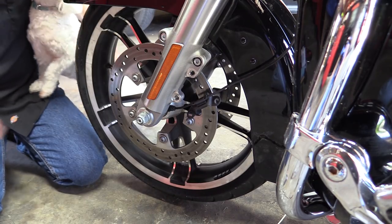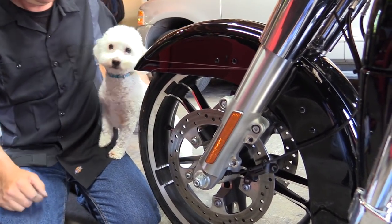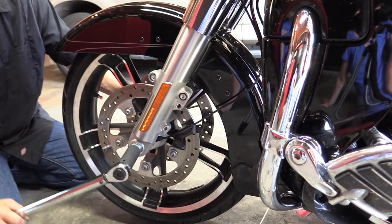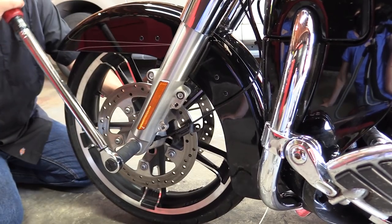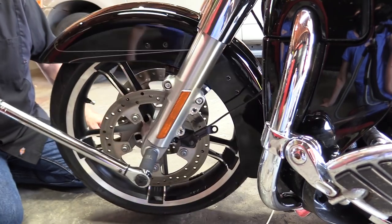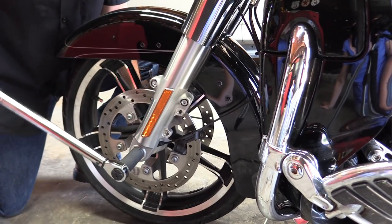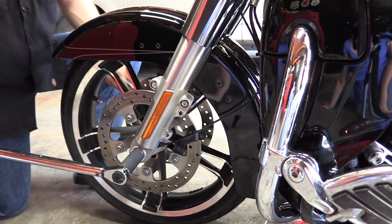This is Twinkie — she came in to see us working on the bike. Now we're going to tighten the axle nut. To keep the axle stationary, put a long screwdriver through the other side like we did when we took it off. According to my service manual, the torque spec is 70 to 75 foot-pounds. I lowered the bike just a little to put some weight on the front end, which makes it easier. That's 73 foot-pounds.